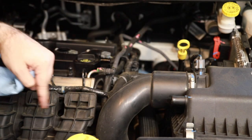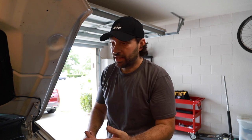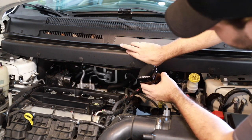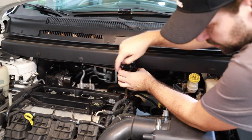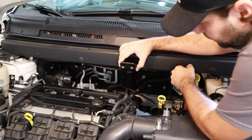With this tiny little engine and this big engine bay, you would think there's an easy spot to mount it, but I'm trying to come up with a spot and I just can't seem to find anything close enough. If I mount it on the other side of the engine I have enough space, but the problem is I'm gonna have to run lines back and forth, which I don't really want to do. What I'm thinking is to mount it right here — this is just a cover holding the plastic against the metal behind it. If I remove this and mount it right here, I have a short hose going in and I might even use the original one, and I still have enough space for it to be serviced. Let's see if it fits with the car cover.